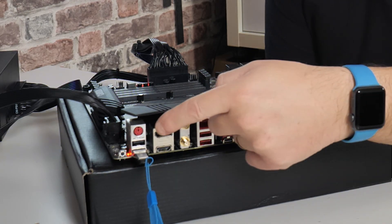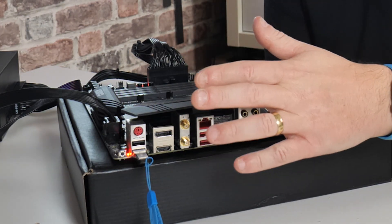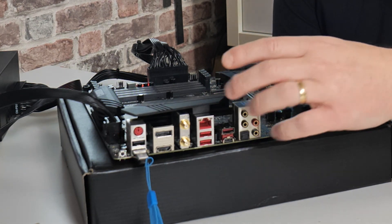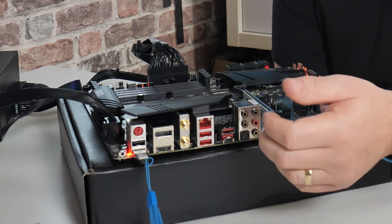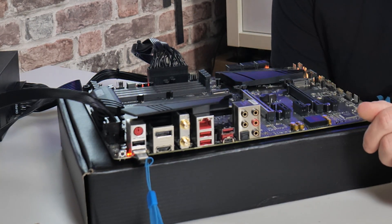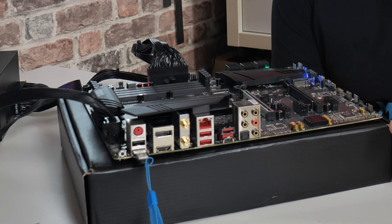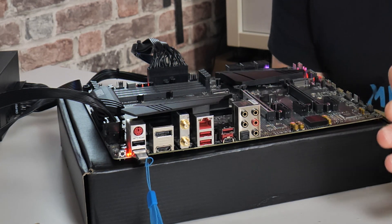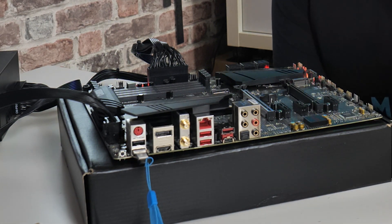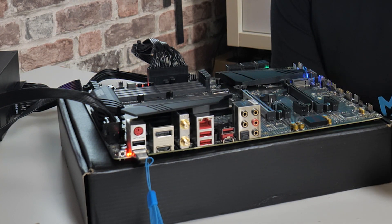You can see now the BIOS flash button LED is now flashing fast — that's the next part of the process. If it doesn't get to this point within one to three minutes, something has probably not worked and you'll need to start again. We'll let that carry on and it should change speed again shortly. There we go — it's slowed down a little bit, which is a good sign. It's done the wake-up section, done the read, and now it's doing the write. This should be the last part — probably about another minute or so.